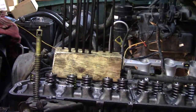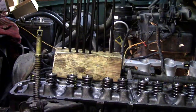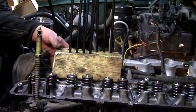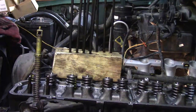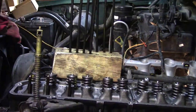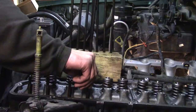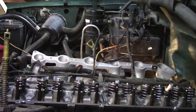After fighting a long time with the exhaust and lower intake manifold, it's time to put the push rods in. The motor is going back together a little further. They recommend putting them back in the same spot you got them from — we generally do try to. We have a block of wood that we mark with where they're at. You also want to make sure there's a little ball on each end, and that the lower end goes into the lifter itself and is seated into the lifter, otherwise you'll have big problems later.